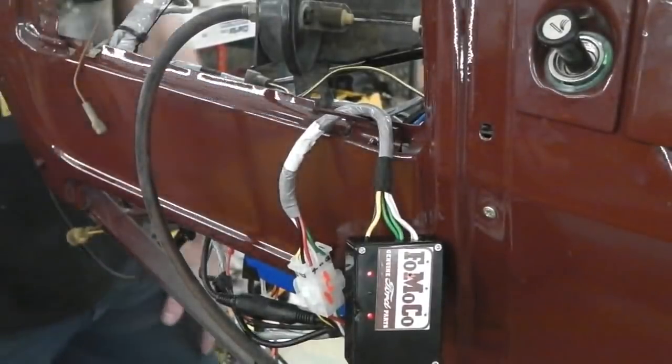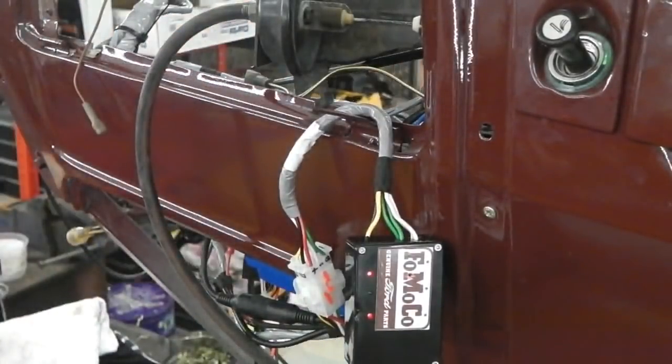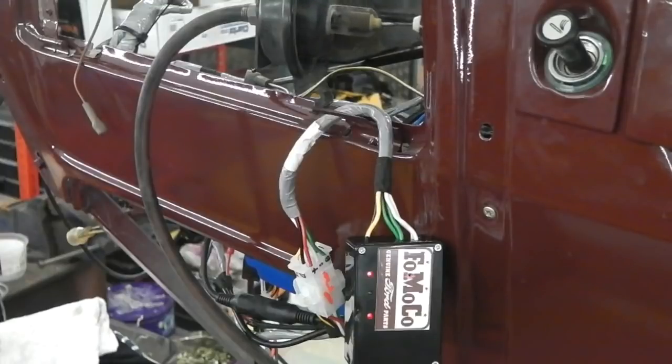The cruise will die because it loses its minimum speed, and the lockup will die as well. Here we go. Cruise going to die. Cruise just going to a slower speed, sorry, because I've sped up on it. So cruise drops the throttle. Down it goes again. Everything happy. Lock and torque lockup should still be on. We're hanging around this higher range.